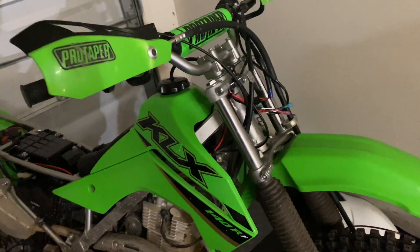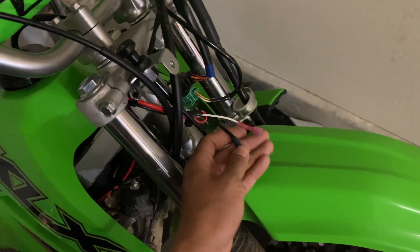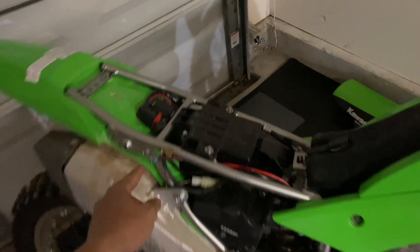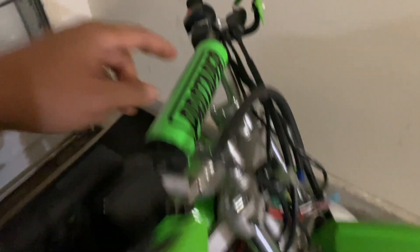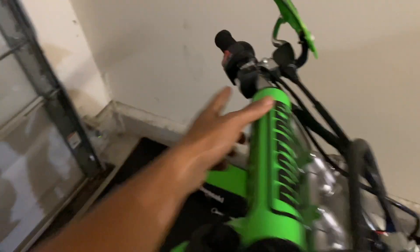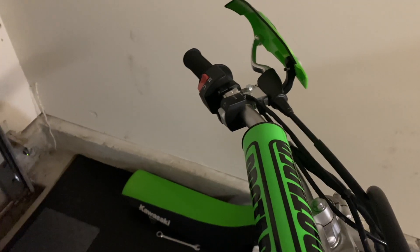Before I reinstall the headlight, I just want to go over the wiring — it's much simpler than it looks. There are only two wires that hook up to the back of the headlight: one is a negative and one is a positive. This black wire runs straight through to the terminal that hooks up to the negative post of the battery with no break in between. The positive, however, has an inline fuse. From that inline fuse it goes to the switch, and from the switch it goes to the white wire. All this switch does is either complete the circuit to turn the light on or break the circuit to turn it off.